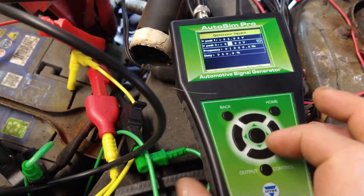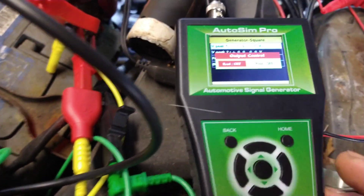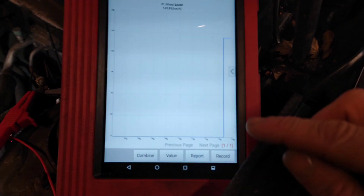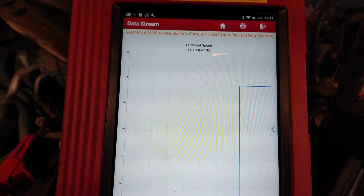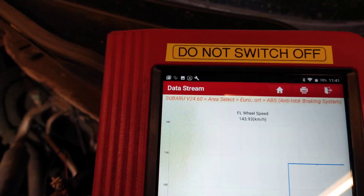So there's a square wave going in there. I'll switch the power signal on. It's come on and we can see straight away it's recognizing the speed. For this alternating current that's generated we're using this sensor simulator, and it's reading one hundred and forty-five kilometers an hour.